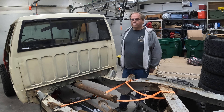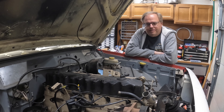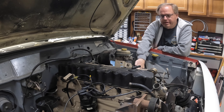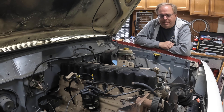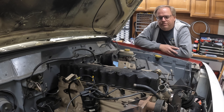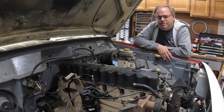We measured this and it has about a 121-inch wheelbase currently with the axles in the factory locations. I actually don't know exactly what wheelbase we're going to end up with because we're looking at possibly moving the front axle forward — we'll get into that in detail later. And of course being a truggy, I can move the rear axle too since it's not hanging on a leaf spring, so we'll figure it out as we build.